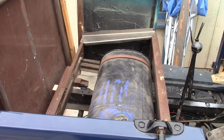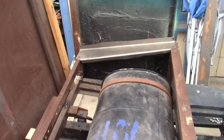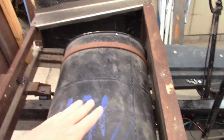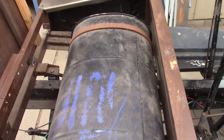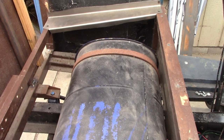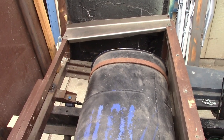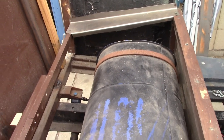So, here's the new design. When I put this together originally, I didn't make much of a science of where the seats go, which was a mistake. The bottom cushion before, front to back, was just level. I had it as low as it would go without touching the fuel tank. And because it was level, the back of it was up pretty high, which made me sit really high, and I had no leg support on the front of it. So I redesigned it. This is now to the dimensions of the 22 to 25-ish bodies — the ones that use the oval fuel tank.